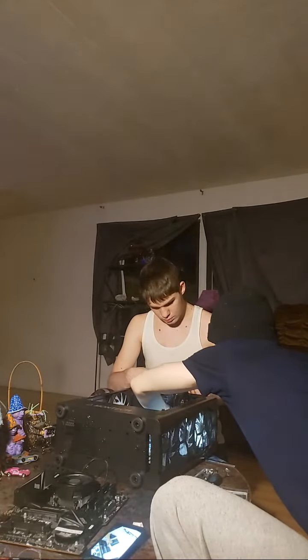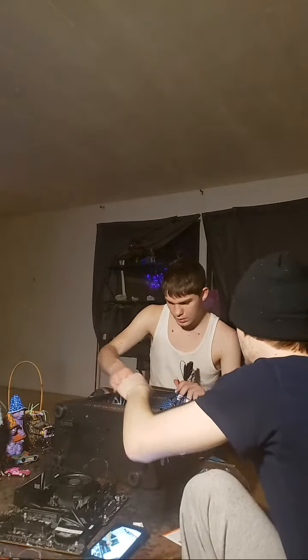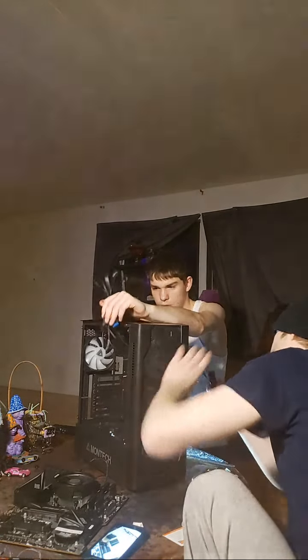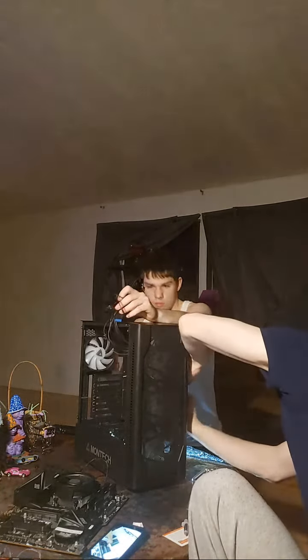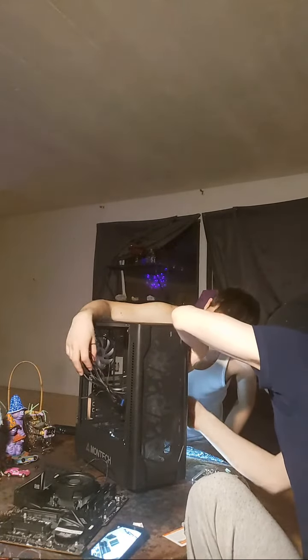This can be a little tricky on the end, because I'm assuming these are going to connect to the motherboard. Pop it in, and you have to kind of do it by feel. Keep them on the end, so you hear that sound. Look really closely to make sure that the entire perimeter of your I/O shield is flush. So you just want to double check, push it firmly around the edges, make sure it's all good in there.